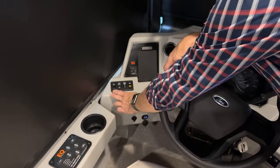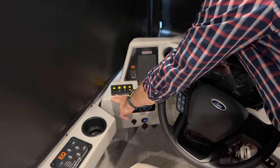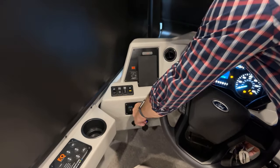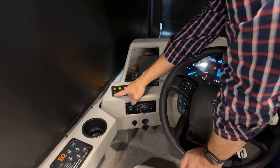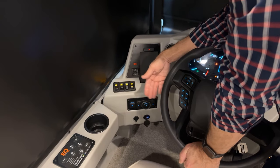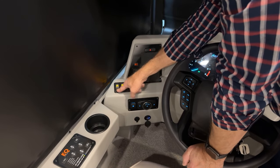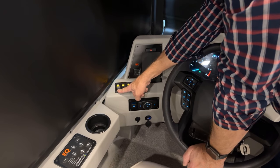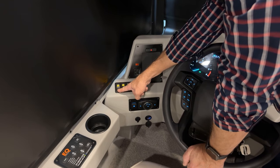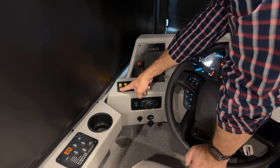You have your battery boost — we'll illuminate those switches by turning on the ignition. If we have a chassis battery that can't crank the engine over to start, we can boost that chassis battery by holding this down for 30 seconds. That connects the house batteries to the chassis batteries, and we should be able to start our engine.